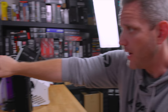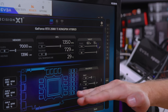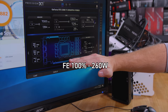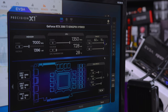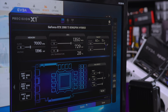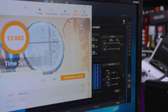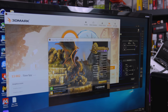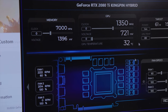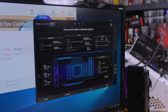Starting by maxing out our power limit to 144% — 44% above 100. The 100 from the RTX Founders Edition model's baseline moves up, so it's 44% of the new 100% power limit. We're also going to prioritize GPU temp. By raising the power limit to 144, we gained no score whatsoever — we went from 15,776 to 15,749, which is all within margin of error.